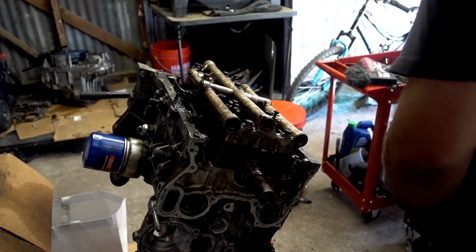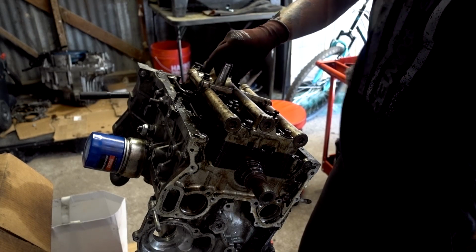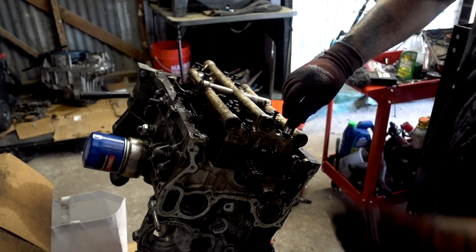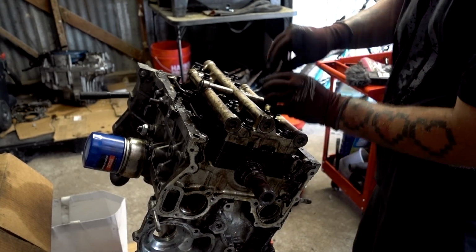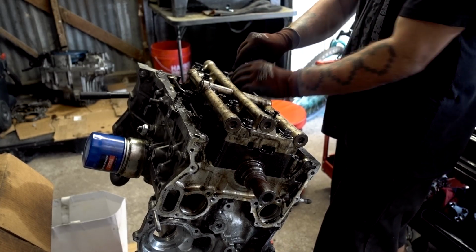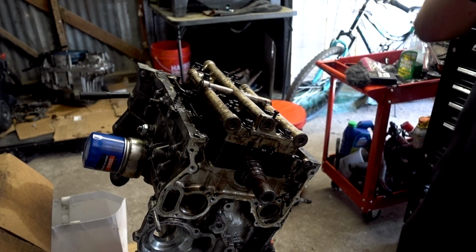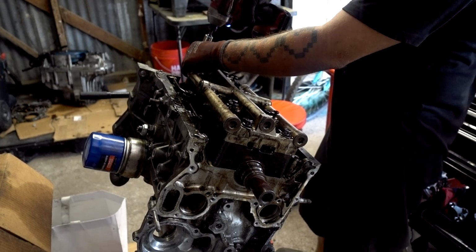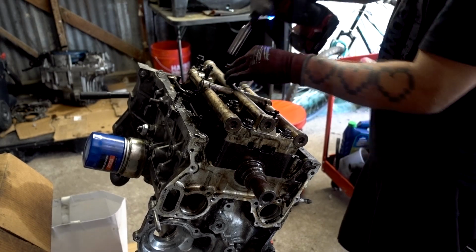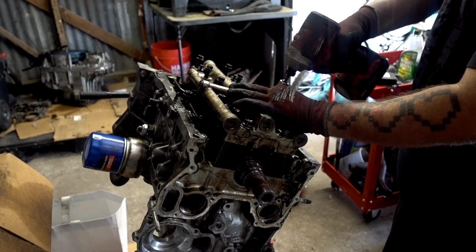Okay. Now, I always like to check with my hands first. If I can turn it by hand all the way around, there's no torque on any of the bolts, which means it's okay for me to use my Ugga-Duggas. Because if there's no torque on them, you have nothing to worry about. This whole piece now is free of torque, so you will not have to worry about anything getting damaged or warped. And you don't even have to go in the crisscross orientation anymore. That is only for torquing, in case anybody was wondering.